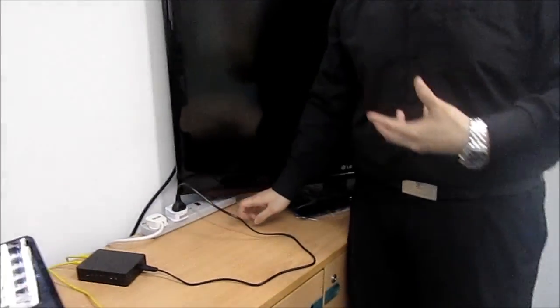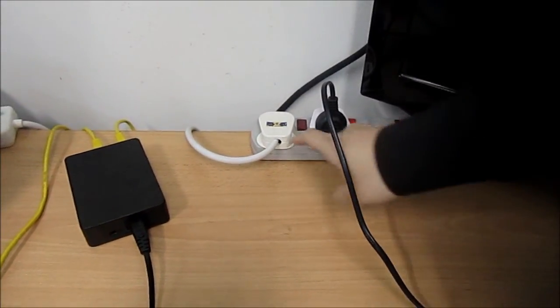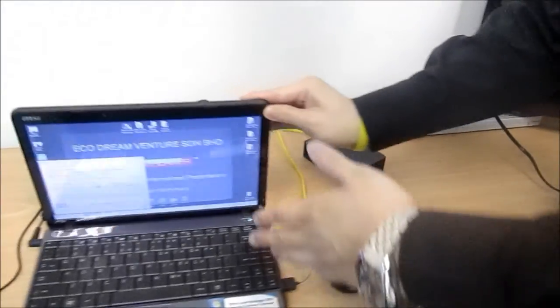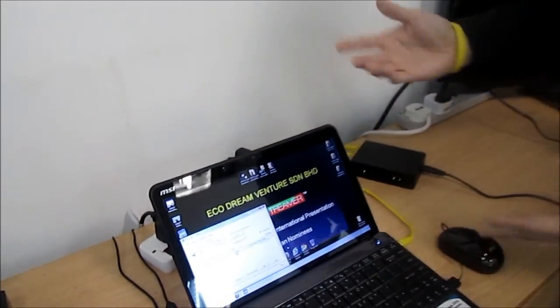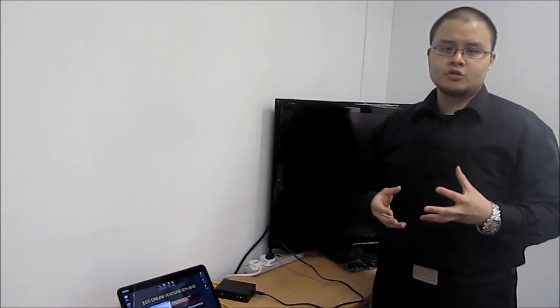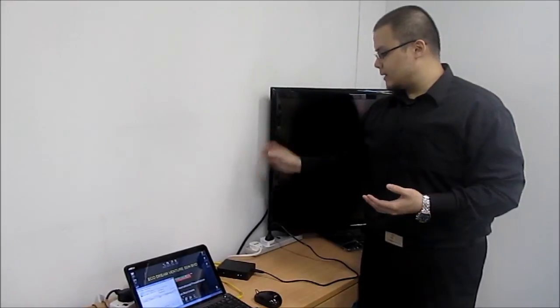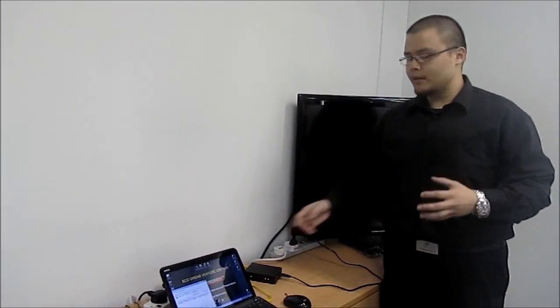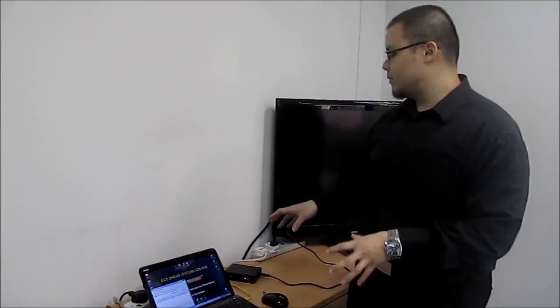Because this station here draws power supply from one electrical wall outlet, we do not have the choice but to use a power strip. There are two plugs here — one is for the powerline adapter and the other one is for the interconnected equipment. Only the power supply for the WD Livewire has been turned on and the one for the interconnected equipment has been turned off, making this power strip the only power supply for the WD Livewire powerline adapter. Experts also recommend that your powerline adapter and your interconnected equipment should not share the same power strip. Again we had to do so because we were confined to a single electrical wall outlet, but the power supply for the interconnected equipment has been turned off. Also experts recommend that you should not use a surge protection device in conjunction with your powerline adapter, so the surge protection device has been removed from the setup. And experts also recommend that any noise generating equipment, for example your mobile or cell phone charger, should not be in the same setup as your powerline adapter.